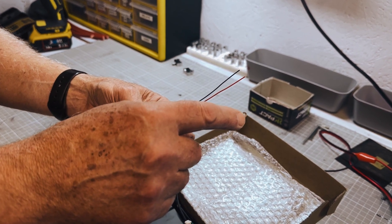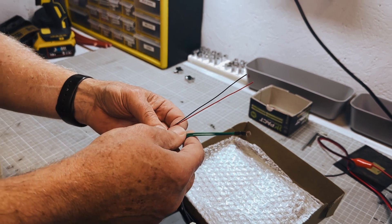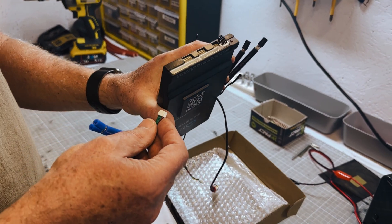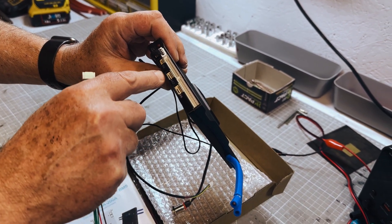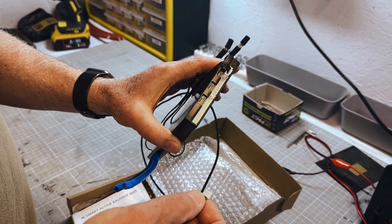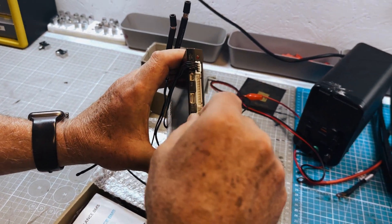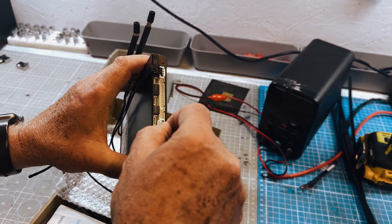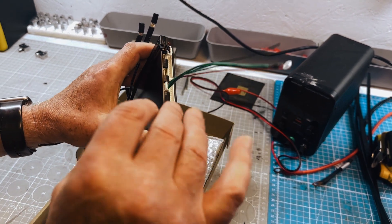When the cutoff temperature is reached, it will connect the green wire to your neutral. You take this to the neutral of your heating pad, and for the positive you go to the main positive terminal of your battery. Your JK BMS will have Chinese writing with no English, but this cable only fits in one place — not the switch port, only this one specific plug.